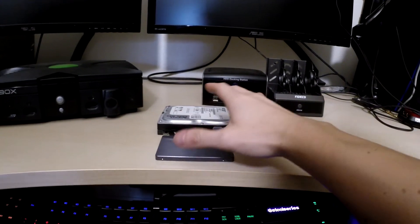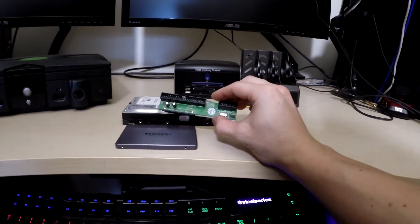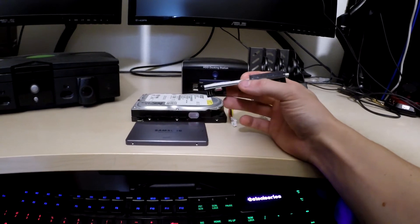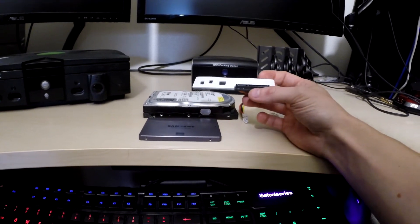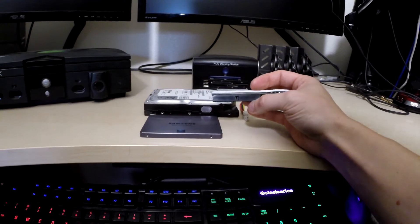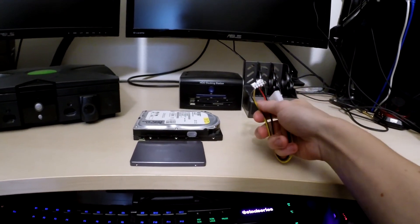Something else you're going to need: these SSDs are SATA, but the original Xbox interface is a PATA interface with Molex connectors, so you're going to need one of these — basically a PATA to SATA converter, just a little board. The one I'll show you worked for my brother but tends to be pretty slow and sometimes the Xbox doesn't even get into the dashboard, so I won't recommend that one. I'll show links to the ones that didn't work for me so you can avoid the same mistake. One that does work is a StarTech adapter — I'll link to that in the description. Depending on your adapter, you may also need a Molex connector to a smaller 4-pin one.